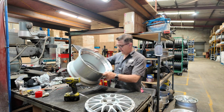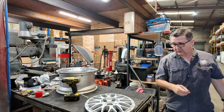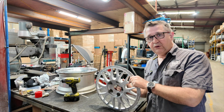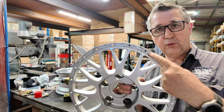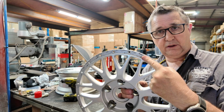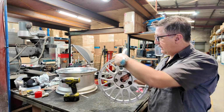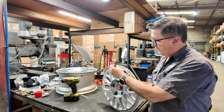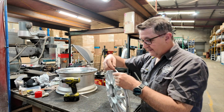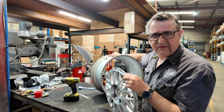The other thing that I'll point out now is when you mount these things from the back, do you notice it's got a little relief where the bolt head's supposed to fit in? Right, fits in like that. So when you bolt this in from the back, your screw is pulling down on a void. It's squeezing that into a void, which is just really not a flash idea.